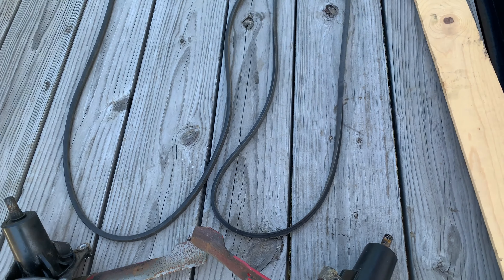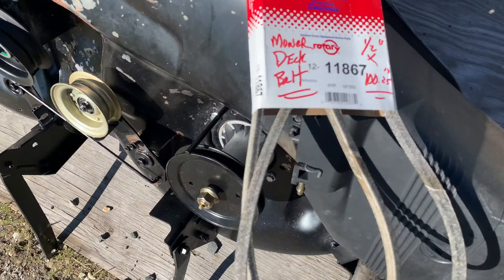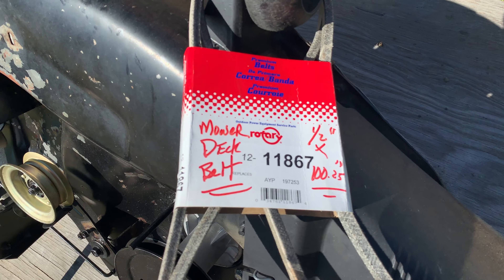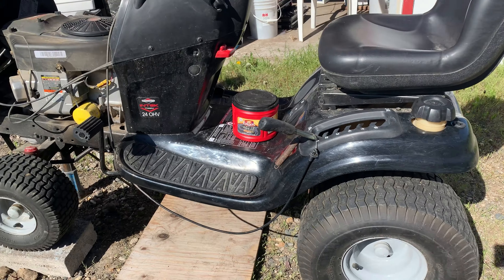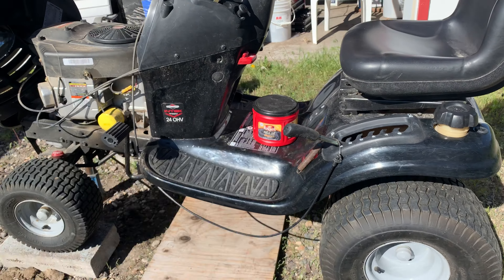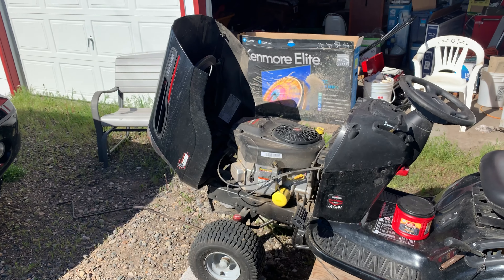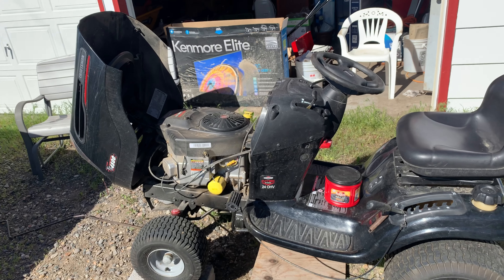You've got one belt that drives your deck assembly for your blades, and another belt for the tractor itself — the movement of the tractor. There's the mower belt; I'm getting ready to put it on, just waiting for that brake assembly from FedEx. That's half inch by 100.25 inches. The other belt that drives the tractor is half inch by 92.5 inches. The whole entire engine's been tuned up — oil filter, spark plugs, air filter, fuel filter, oil — all that.